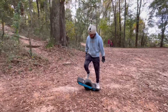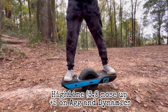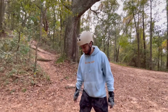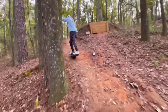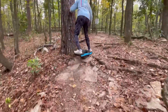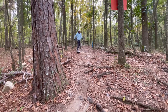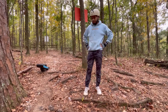This is the last try for the GTS: highline, dynamic responsiveness five, tilt all the way up to three, aggressiveness five — basically everything to five. We're going to see what that does in highline instead of apex. Far less motor slip — and there you have it, made it further in highline than apex, just because the control of the power is better and doesn't give it so much so suddenly. Very interesting.